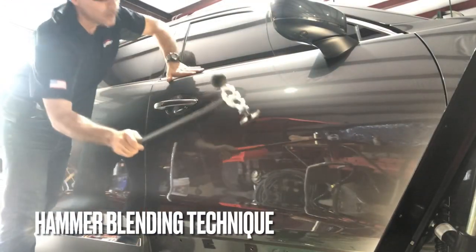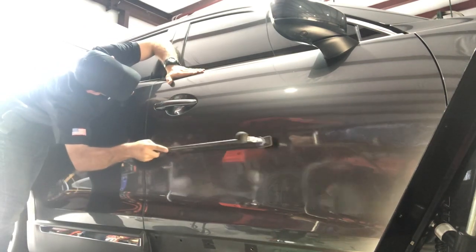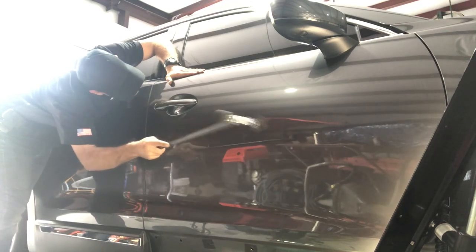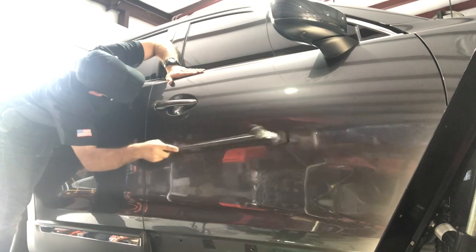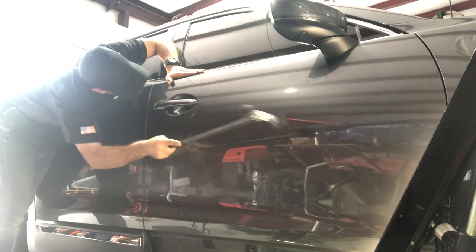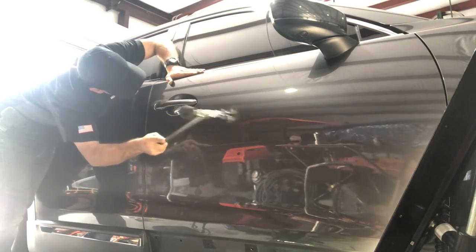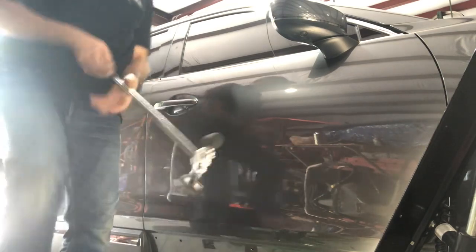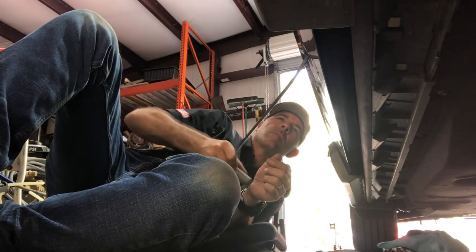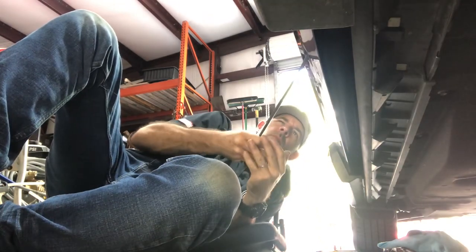At this point, we're doing what's called blending. Blending is the art of basically causing a vibration on the distorted metal areas and sending that metal back into its natural position. And we're going to sit here for hours doing this until that metal is 100% flat again. Now, this particular metal on this Mazda is very difficult to manipulate because it's made of what's called high strength steel, which literally has twice the tensile strength of regular mild steel — it's just very hard to put back into position.